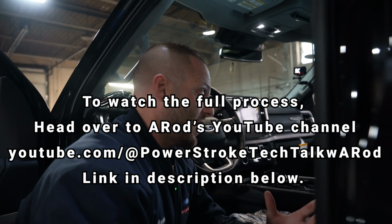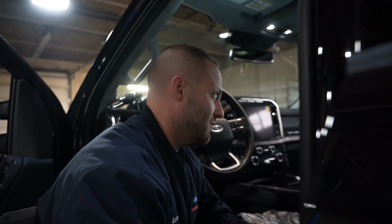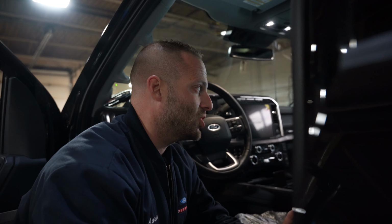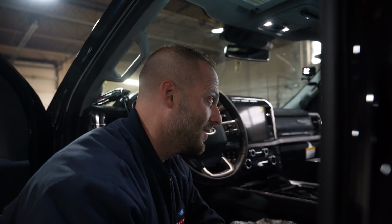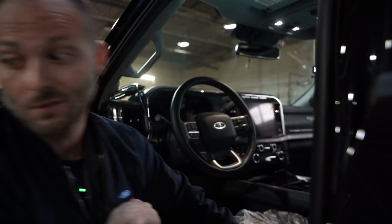And then once it starts that, we're just gonna sit here for a few minutes, and then it wants us to carry out 5 acceleration events from 0 to 15 miles an hour, bring the vehicle to a stop, and idle the transmission in park for a minimum of 30 minutes. What you're doing here, you may think this is hard, but it's even worse for other brands, and I think even for semi-trucks as well. So bear with us. We're gonna get this thing outside and start this silly procedure.